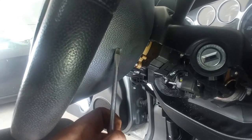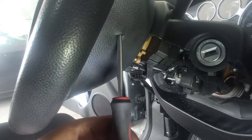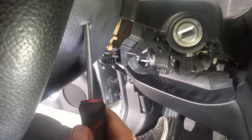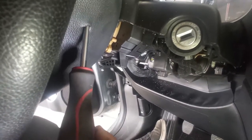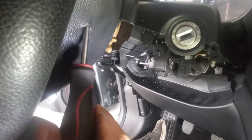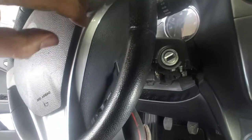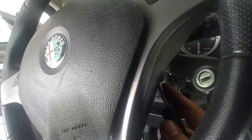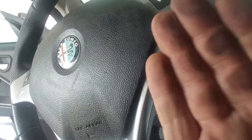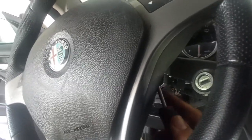Let me try to do this one-handed — it will go in as you work it. Now you want to twist it and as you are twisting, work the airbag out. Do not use too much force. You have to feel what you're doing. Now put your fingers over here and pull out this side of the airbag, then do the same on the other side and the airbag will be off.